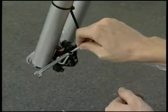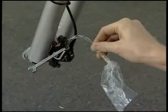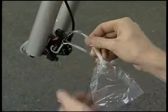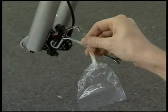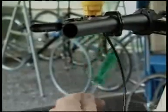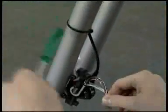Connect the tube fitted with the bag to the bleed nipple and then loosen the bleed nipple. After a little while, the oil and air will flow naturally from the bleed nipple into the tube. In this way, it will be possible to easily extract the greater part of the air remaining inside the brake system. It may help to shake the hose gently or to tap the reservoir tank or caliper gently with a screwdriver or move the position of the caliper.